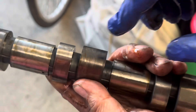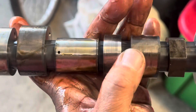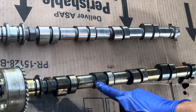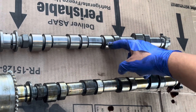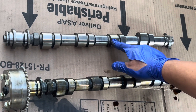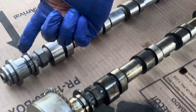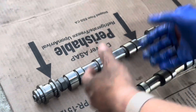We got the intake camshaft off and you can see right there the wear and tear — when you bring your finger through it you can feel it. This one right here as well, you can kind of see it. The new one from BOE is a much harder material with a stock grind, meaning you don't have to retune — you just use the stock tune. But it's more reliable; this one is not going to wipe as often. We have to transfer the gear sprocket over to the new camshaft.